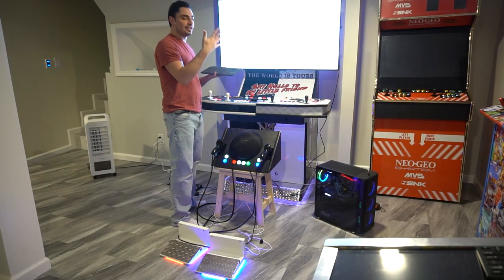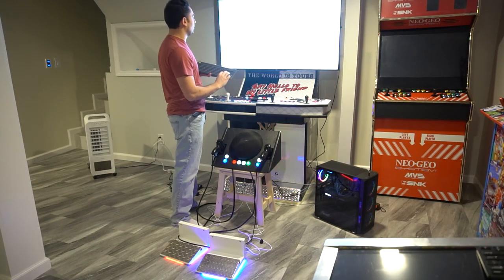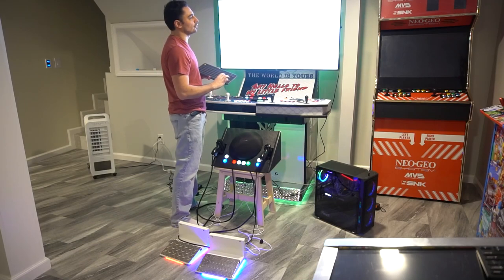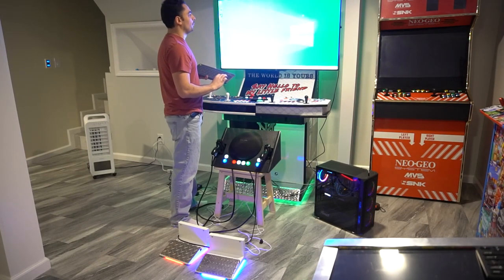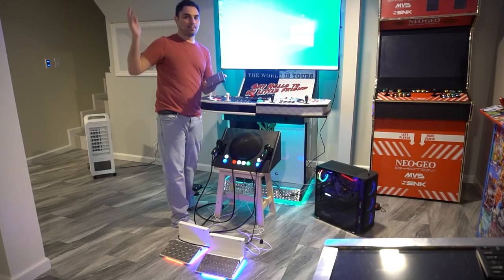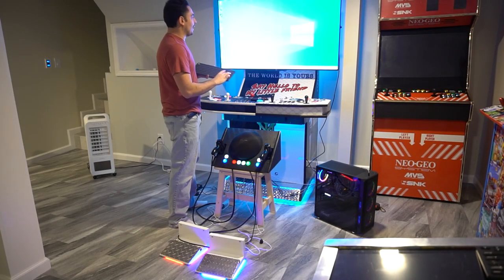In this situation, he has 1080p, so you're going to switch it to 1080p, and you're going to want to make sure that under change the size of text, it's at 100%. So big thing, for example, this customer is going to get it, and it's going to launch Big Box, because I'm going to have it set to 30 seconds, so you're going to have to exit out of Big Box and such.